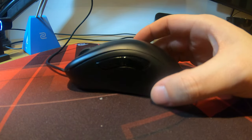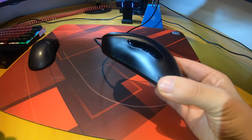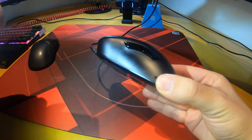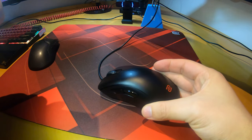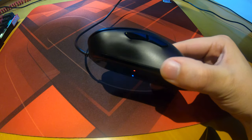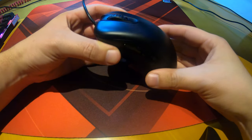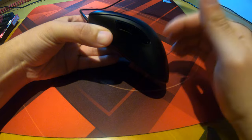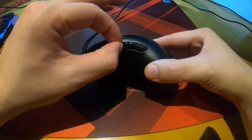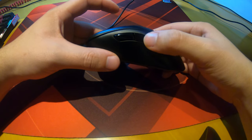Compared to previous mice such as the EC2A, the coating on this version is a lot less susceptible to sweat and is less likely to reveal a glossy streak over time. It's worth noting however that even after a long period of time a glossy coating will still be apparent on the mouse, so it's recommended that you clean the mouse regularly. The mouse benefits from having a solid shell with no holes to save on weight, so the build quality is premium feeling with no signs of flex or wobble. Mouse 1 and 2 have a slight amount of flex, however this isn't something you can purposely do when holding the mouse, and the side buttons have no wobble either — just the travel issues mentioned previously.